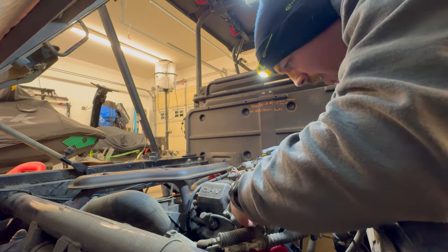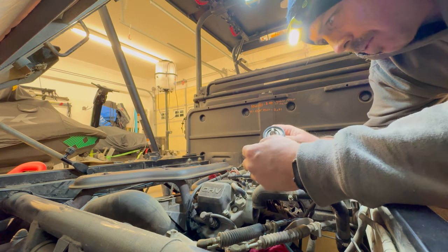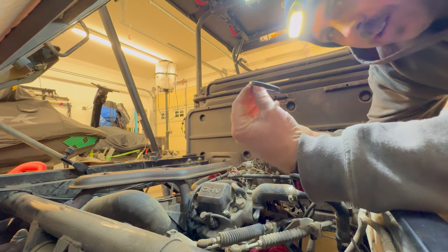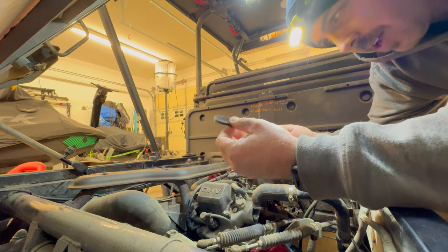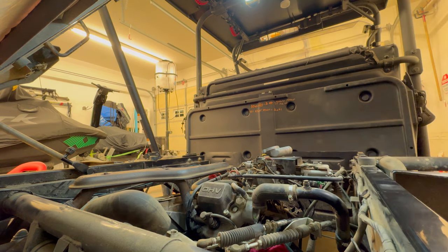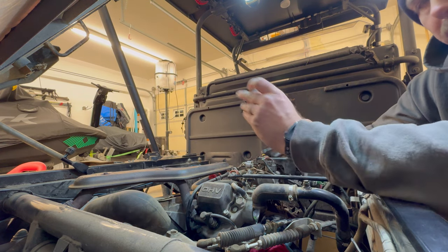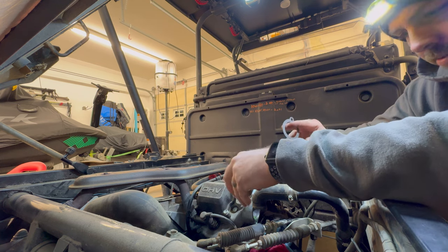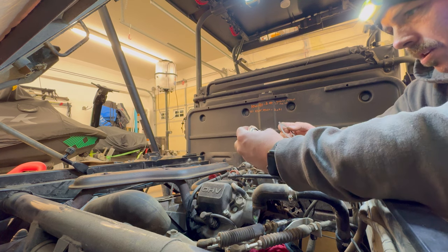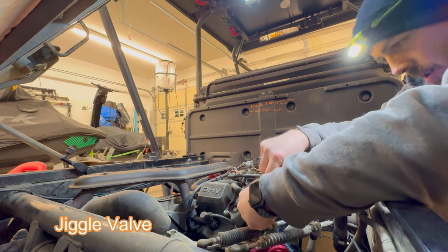If you got the same kit I did, it has a rubber gasket on it — that is not correct, do not try to install it with that. I don't know why it has that. All you need is the actual paper gasket. There's no gasket needed on the spring side of the thermostat or the engine side because it's actually recessed in there. This gasket just sits on the front. Remember, we're going to put that little bleeder vent at the top because that's how the old one came out.